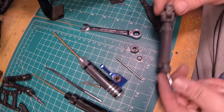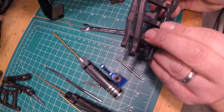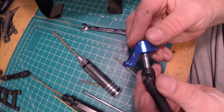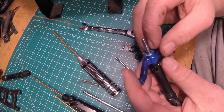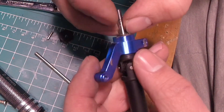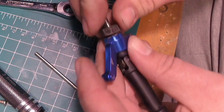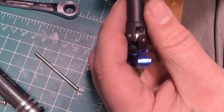Alright, so now the drive shaft — we don't need that. A-arm — no longer needed. Once again, the shorter ones are going to be going on, and then the shorter drive shafts, so we can just put those to the side. Grab your shorter axle and essentially just do the opposite of what you just did. I had two washers or spacers on here, so I'm going to put them back. There's a ton of play here, so I might need more depending on what happens once we get it back together. We'll just have to see how she rides. I'm going to go ahead and just put the axle back in.